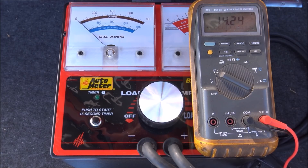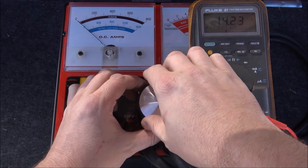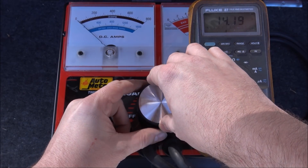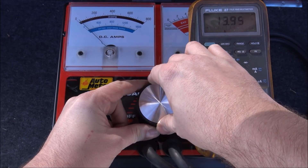This alternator has an idle output of around 180 amps in this vehicle, and as stated, this being Part 1, we will have an enhanced follow-up video with somebody maintaining 2000 RPM so we can achieve full alternator output during this same series of tests. On our first test here we will see what we can sustain at 12 volts. We will run two tests to see what our continuous amperage power output capabilities are at the 12-volt area.